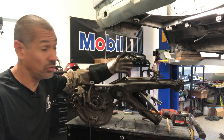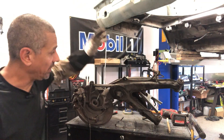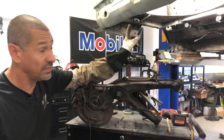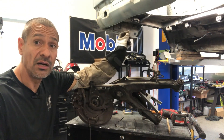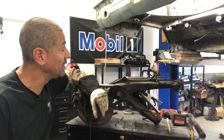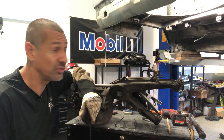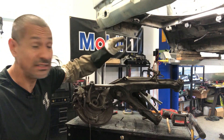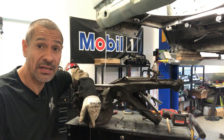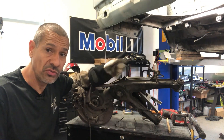Down the road everything is going to be torn back down and powder coated, and that's not looking too far away once stage one is complete. I'm going to do the other control arm, then work on the upper strut tower reinforcement — grind down the red powder coat and weld it in place. After that I'll install the spare tire delete plates, which will make this section essentially complete. There are still front reinforcements to do, so stay tuned.